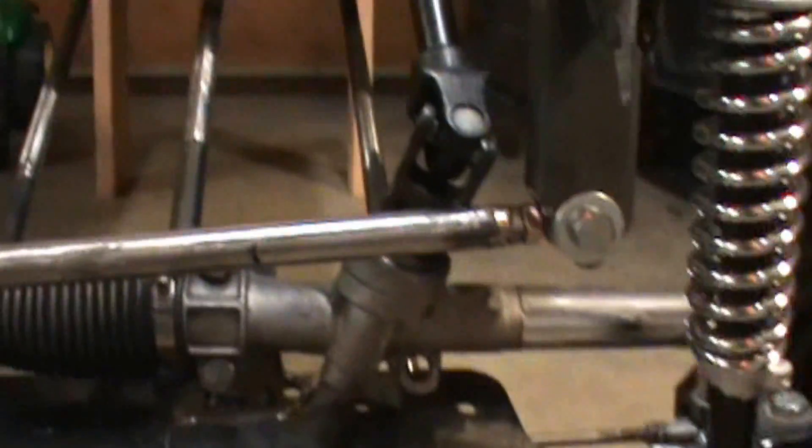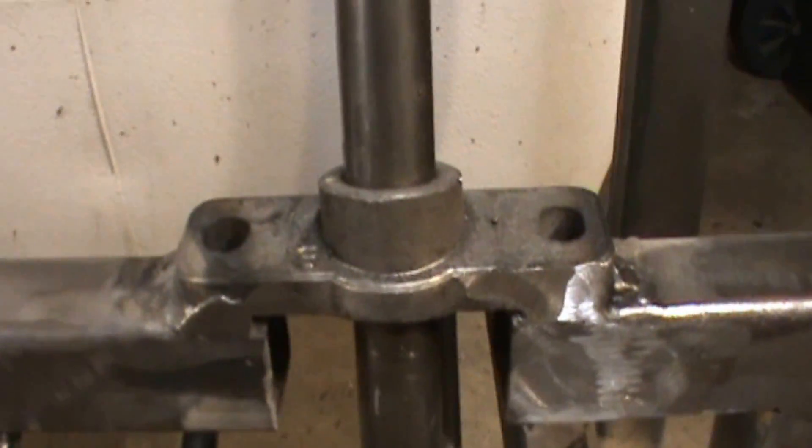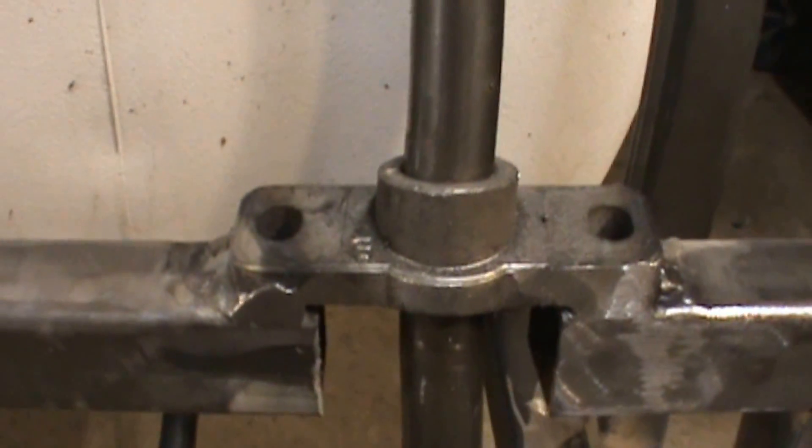With it being in a more vertical position, this puts the yokes on the steering column in a better position. As you can see here, I made this bracket and welded it onto the frame — pardon my welds, they're terrible, but they will hold and they're strong. All I used here was another piece of two by two tubing and then a piece of one inch exhaust pipe off of some Kawasaki Vulcan 900 exhaust I had. Coming up here, I made this bracket welded to the frame on each side as a support, and that little bracket came off of a Murray wide body steering column.